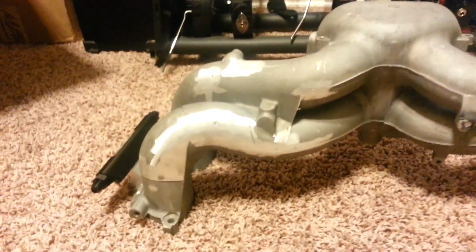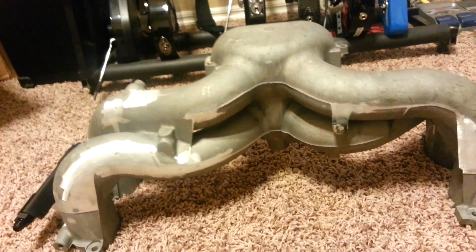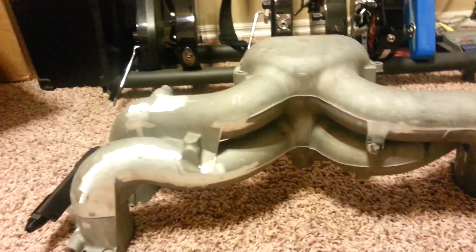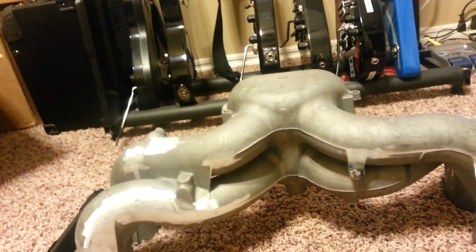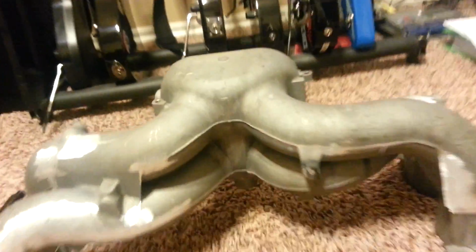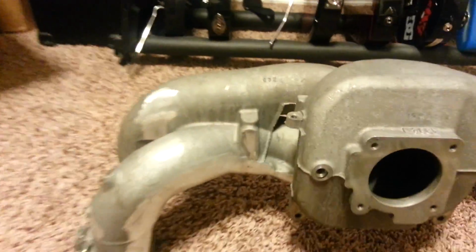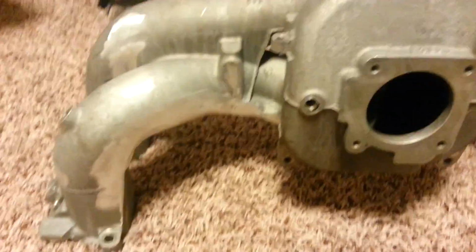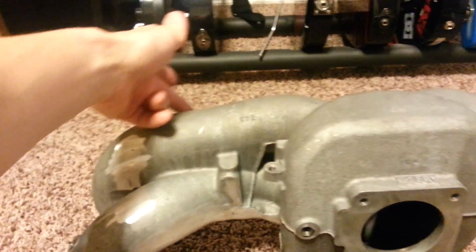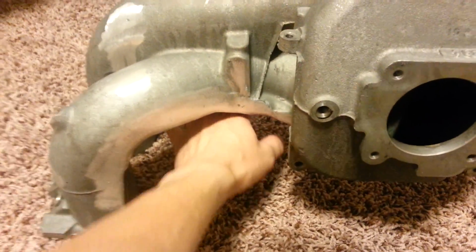My mechanic actually created a plate, like an adapter plate. It's kind of like a kit. It bolts right on, and then you just bolt everything into place, and then it works. But the only downside, where I may not be able to run that setup, is that I don't have a rotated turbo. Because if you were to mount it like this, the turbo needs to be rotated so you can run the pipe to the side. Otherwise it would be facing this way, which I was thinking we could do, and then just run a custom-made pipe here. But I don't know. I need to run it by him. This actually just came in right now.